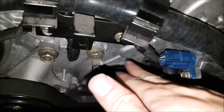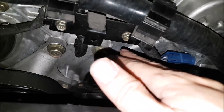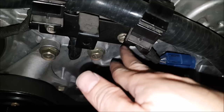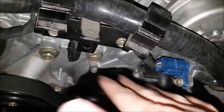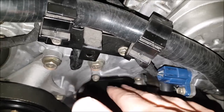I wasn't able to create that drain drip loop over here because of how much length we needed. I don't think we're going to get any water on these — drain drip loops are for when you want it to come down low so if it gets constantly wet it'll drip at the lowest point as opposed to continuing into the plug. I don't think we're going to have that problem here, but just things you have to consider whenever you're running wiring.